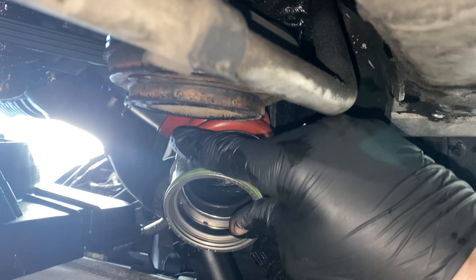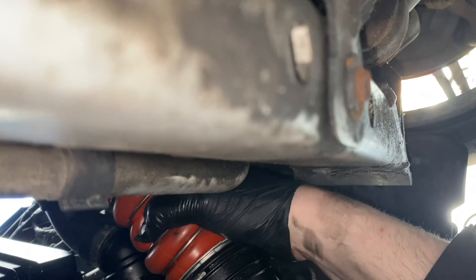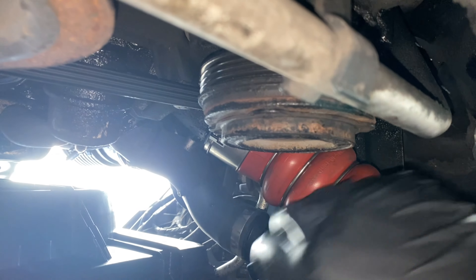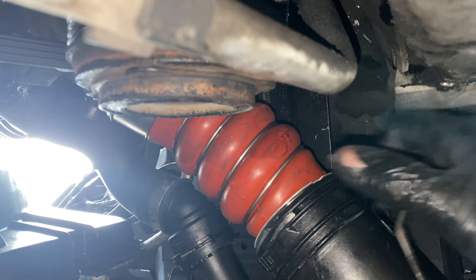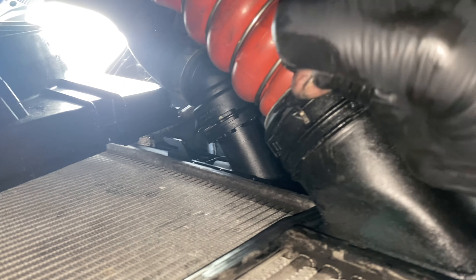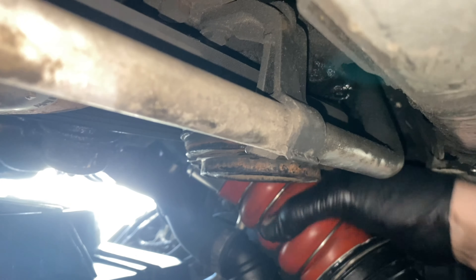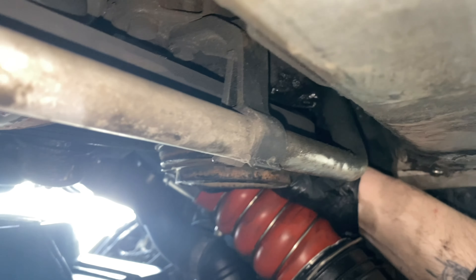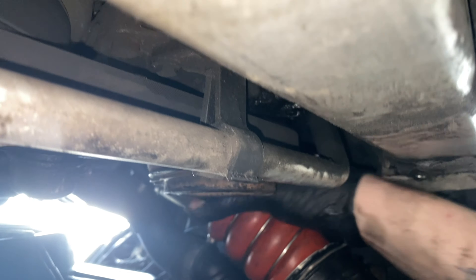Because it is more flexible than the other one it should actually go in without dropping the intercooler down. I need to feed that up onto the turbo in some sort of orientation like that. Then this clip — just by touching it, if it's in the right place — should lock in. With a bit of persuasion this pushes down; there's a little tab round here which you have to line up, and then this should just push back on. That is fitted — it doesn't feel all that convincing, but it is on a rubber O-ring so it will move about a little bit. The bottom does feel better. I'd say that's on.